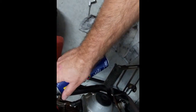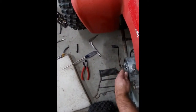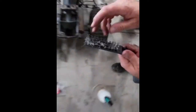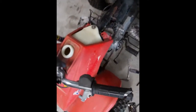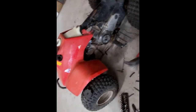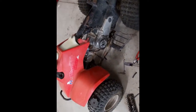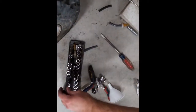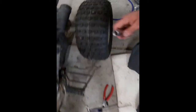This thing hasn't been running — I have no idea how long — so I'm going to squirt a little WD-40 in there so it doesn't start dry. Spray a little WD-40 in there and rotate the engine. At least it's rotating freely. Now I'm going to take a wire brush — a steel brush with plastic handle — to clean stuff. I'll get the spark plug, which has black carbon stuff all over the end. Clean it up a little. The wire brush won't affect the gap. Find the proper socket, probably the 16mm, and go ahead and put the spark plug in.